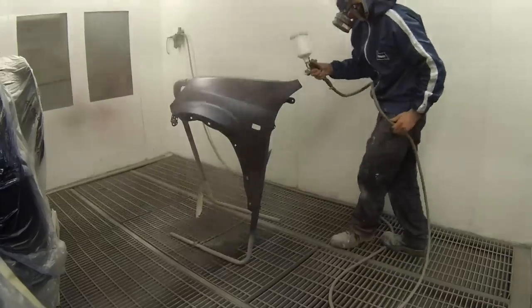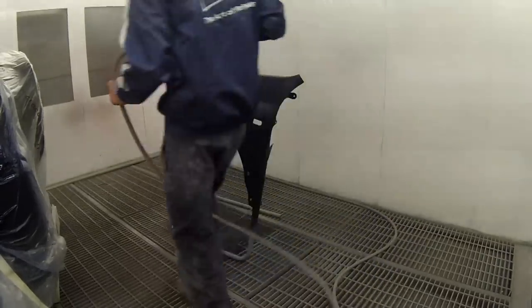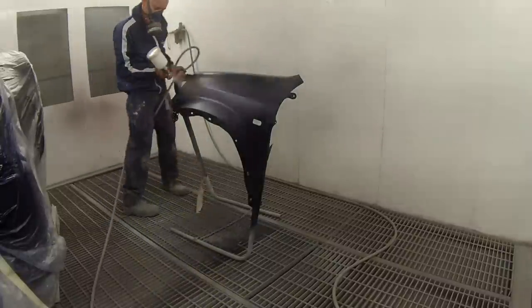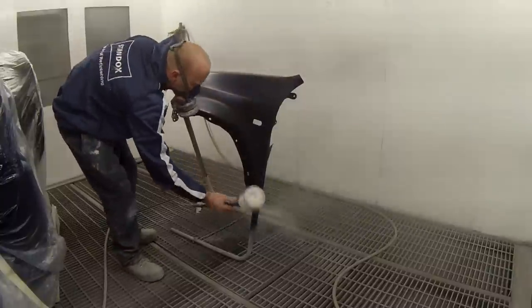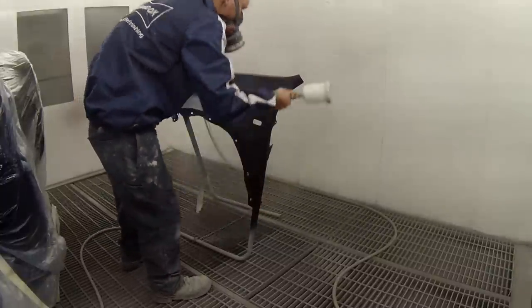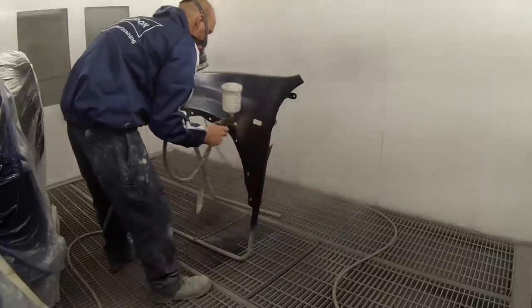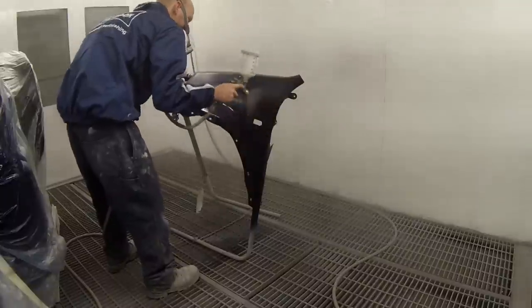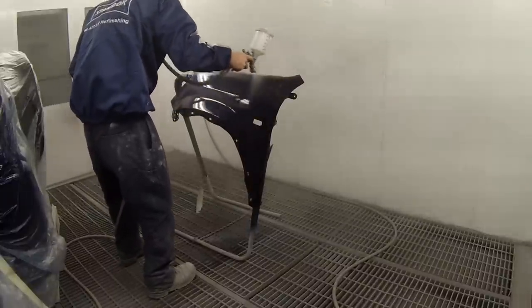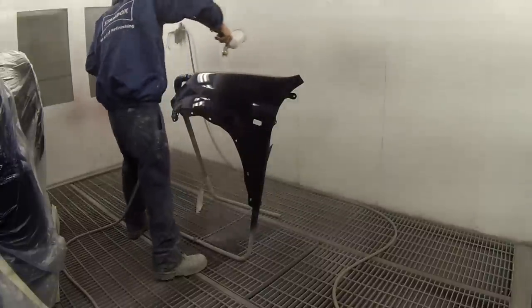A little trick for these fenders: with my first coat of clear I will spray it inside the inner edge of the guard, but for the second coat I will actually not put it up there. If you open the bonnets on these cars they've got a sort of matte finish on the inside. So you put your first coat on the inside edge of the top of the guard, then skip the second coat there, and the overspray lands on top of it and gives it the matte finish that you have on the inside of the guard.